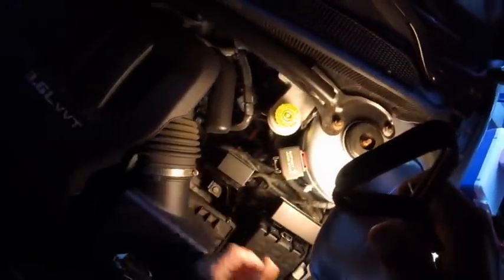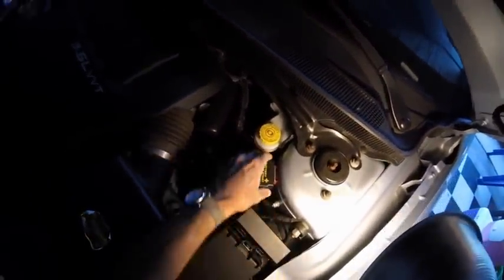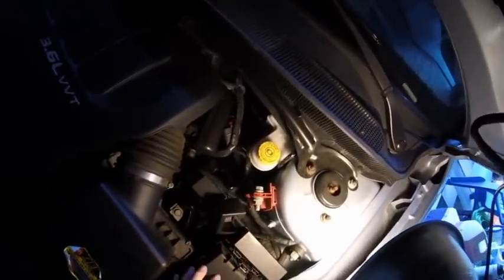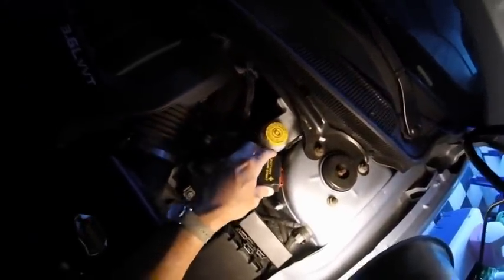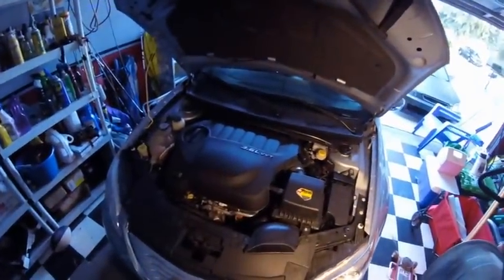As you look right, I'm just looking for corrosion, because you have these cables coming up from the battery there. I'm looking at how thick those wires are going around. And of course eventually we lead up to here, so if you ever need to jump your car, you can take this off and jump it from right here. But what we're going to do is add that additional ground wire. It's not going to hurt anything. Hopefully it's going to fix my issue, but if it doesn't, then the actuator pin is the next step I'm going to take.